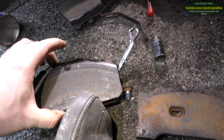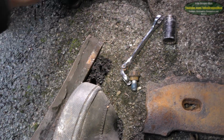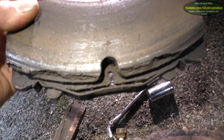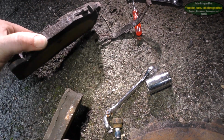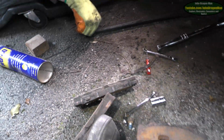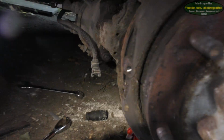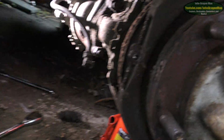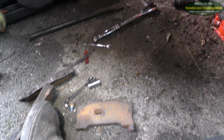You've got to admit though, it is nice you can get a pretty big leak and your brakes do still function to an extent. Hydraulic system, you get a pinhole and... there's a nice crack going through that brake pad. Yeah, MOT tester can't see that. I have got another set of replacement pads for it. Rather nice, it uses the same caliper on the front and the back. It's just a different actuator bolted to it, which is very handy. All brake pads fit. Pretty sweet.